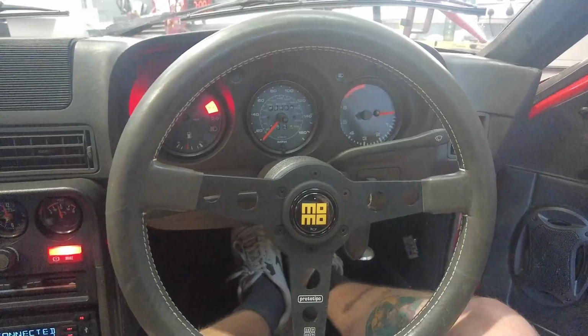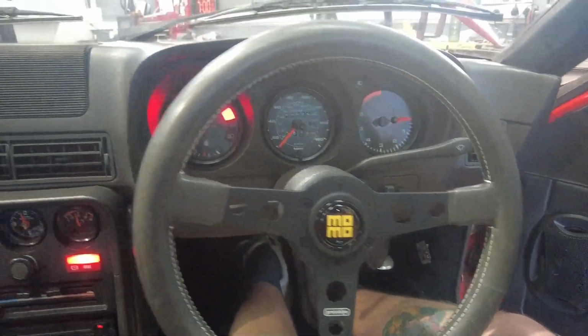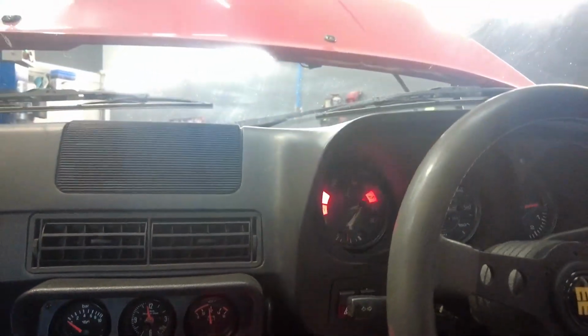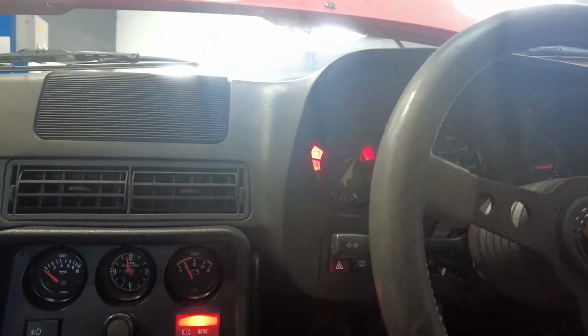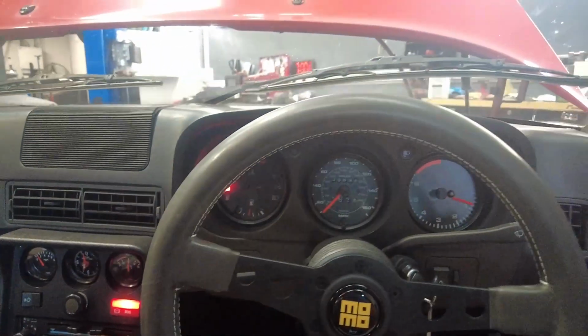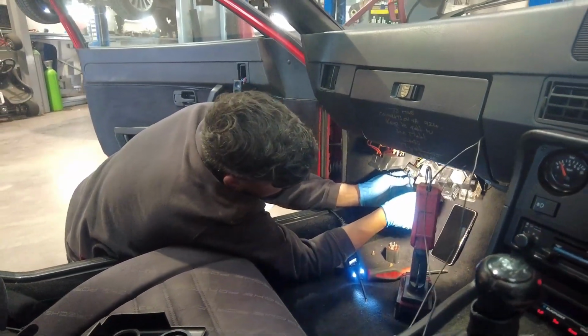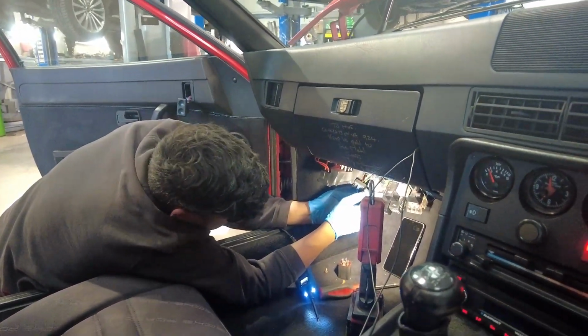We're going to give it a go and crank it while Charlie is basically bridging. It might cough and splatter a bit, but we shall see. Right. So as you can hear, it's running. So actually there's nothing horrendously wrong with it, but we've now got to work out why the relay isn't doing what it should be doing. Next step.